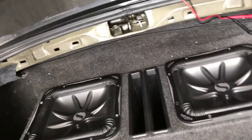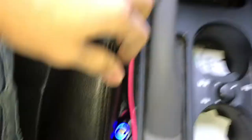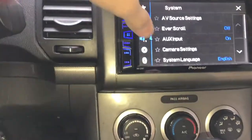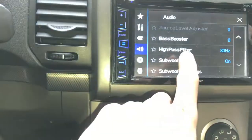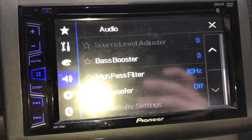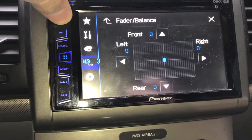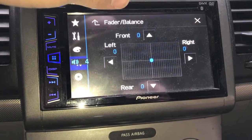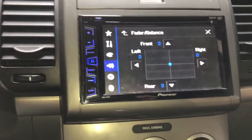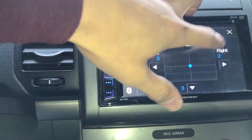Now just to see how they sound. I'm in the front of the car — I'll plug my phone in to listen to music. Bass knob as always. I'm going to show you how I listen to all the back speakers right now. First I'm going to turn off the subwoofers — you can just turn that off right there. I have the high-pass filter set to 80. Since I divided those two leads with the Y-splitters, one of them controls the front and one controls the back.